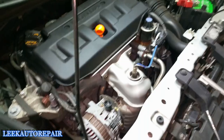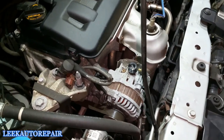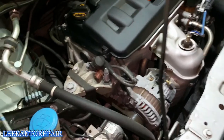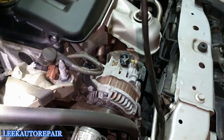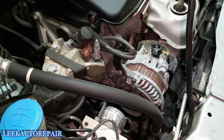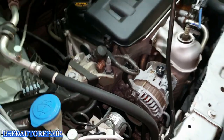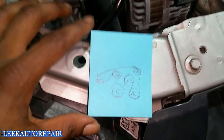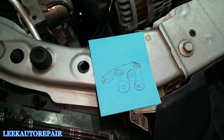This is what I like to do before you take the belt off, because you never know exactly how the belt routes and they're a pain to put back on if you don't know what you're doing. Look at every single pulley — the crankshaft, belt tensioner, everything. Draw a diagram of the belt routing. It looks rough but you can tell what it is. Put it somewhere you can find it.